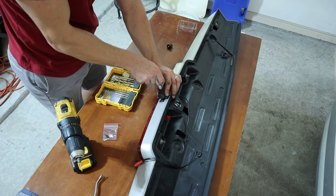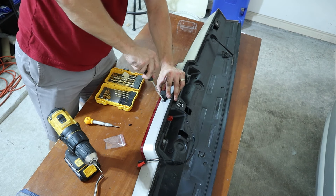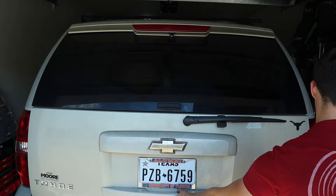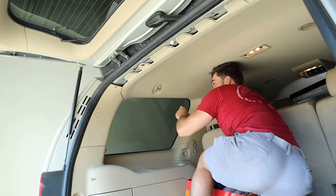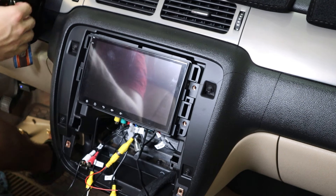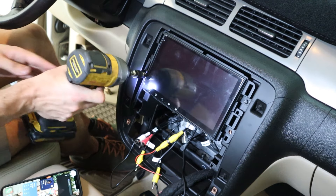I'm now resorting to installing the reverse camera on the roof spoiler. There are two mounting points where the hinges are for the tailgate, then three T25s. Remove the plug and pull that sucker right off. Mark your spots where you're going to drill the holes to mount the camera. Use a drill bit smaller than the screws that came with the camera. Reinstalling the roof spoiler was finicky, but take your time. Make sure the gasket is underneath the roof. I ran the wire all the way around to the front, through the gasket and doors, and finally to the head unit. Plug the yellow aux into the cam-in cord — it says cam in, not video in, and we are done.